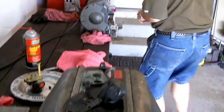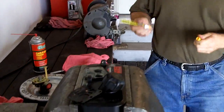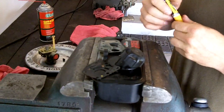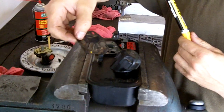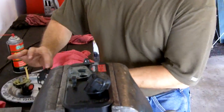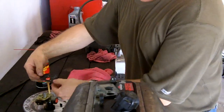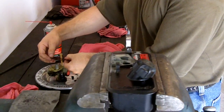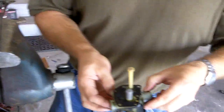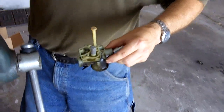What I also like to do — if you're going to take this to the store and match up the gasket — just put a little dot on it so you know that's the way it goes back on, because this is going to be a two-piece gasket. They're actually stuck together, so you want to remember how it went back together. Maybe even before you take it apart, put a little dot on it so you know which way it went. So now we know how it goes and we don't get mixed up.